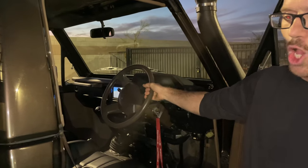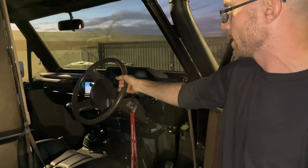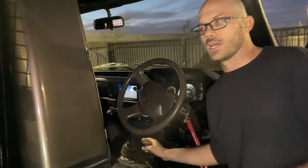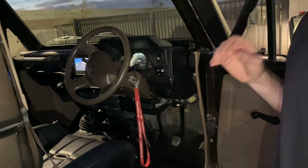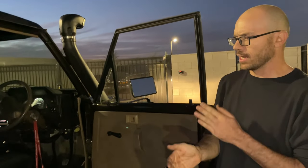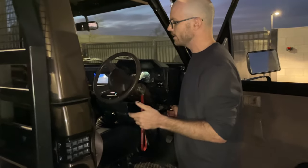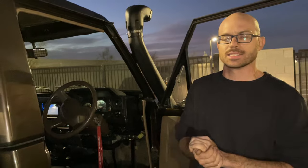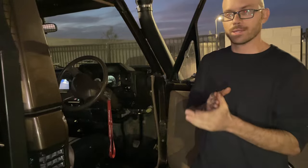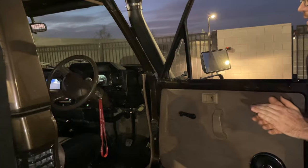It provides a really great low first gear and then a great highway gear behind this motor for cruising at speed. It's got a dual range transfer case that's original as well to this truck. The drive shafts themselves are custom Tom Woods drive shafts from Utah. The engine is mated to that transmission through an advanced adapters kit with a McLeod flywheel and a brand new clutch. Everything's new, drivetrain wise.